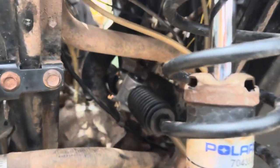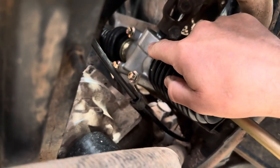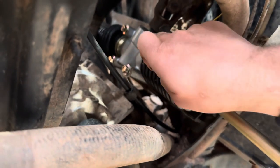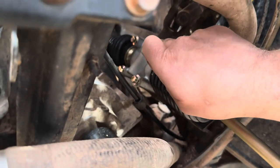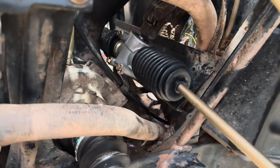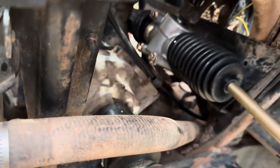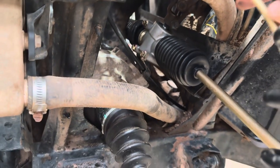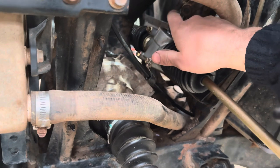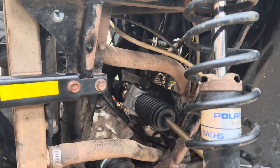No, he doesn't. Right, so, update on the 400. So it turns out the aftermarket steering rack has got one tooth less in the gap that the rack slides onto. So we just ground that out. Oh, look at that little cable holder. That's beautiful. Nice little detail. Took one groove out on the rack and it slid straight on. Tight as a nun's trough. Lovely.